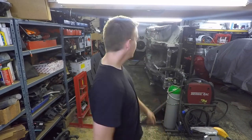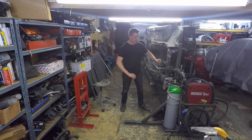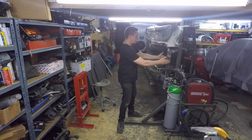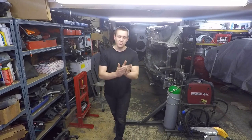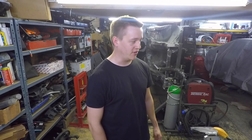It holds things like the radiator mounts and the intercooler mounts, but the more I looked at pictures the more I realized it actually holds the whole front of the car. They have this big aluminium bracket that holds the bumper up and all the cooling packs. They also changed how it's held together — normally it has a seam at the back; they cut it, pushed it around and welded it so you can get the cooling pack right up close and the airflow is a lot better. Skylines get hot on track.